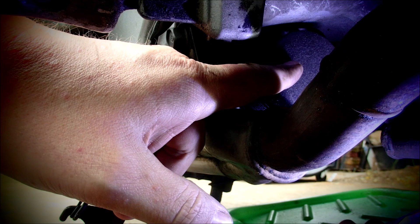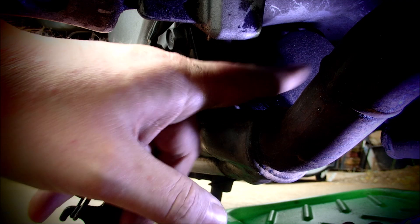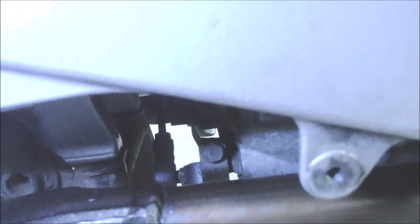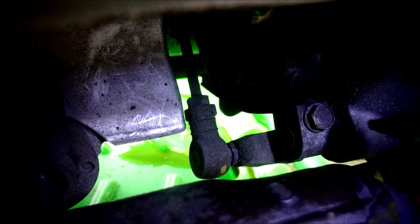Working on the left-hand side of the bike, you can now access the oil filter. We're going to remove the oil filter, which is going to lose us about half a liter of oil that we'll have to replace after the job is done. Now, coming to the right-hand side of the bike, underneath the center of the exhaust you'll see a 10mm bolt — come completely out. We need to wriggle this off and the splines, but not before marking the location and the position on that face.